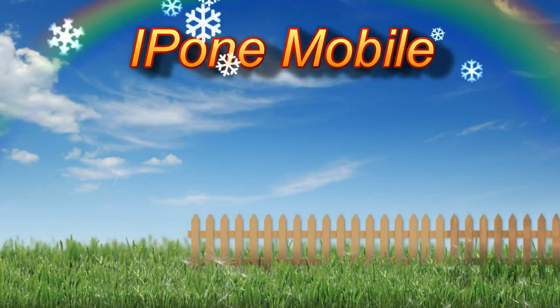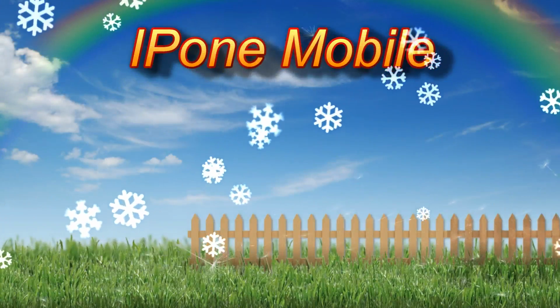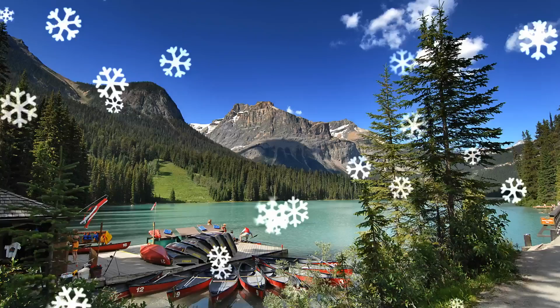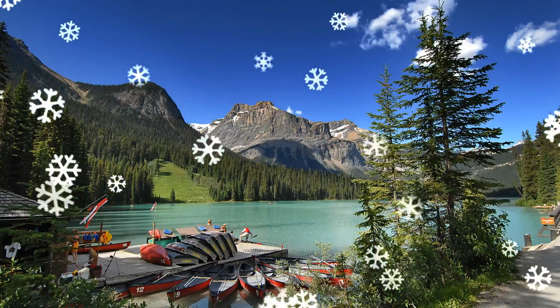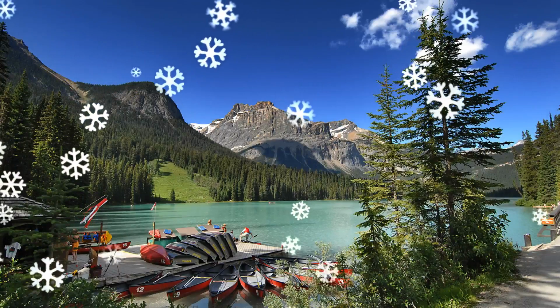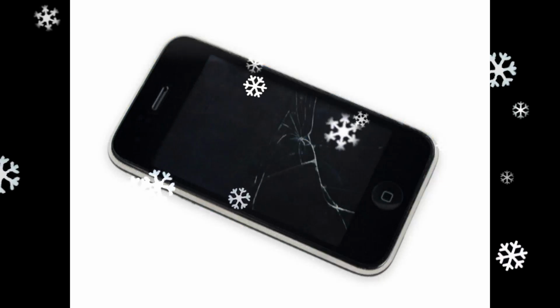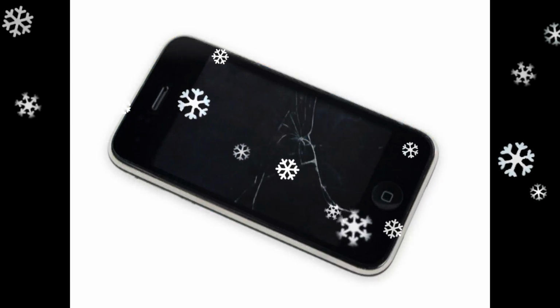iPhone 3G front panel replacement. The display glass is cracked. Keep further breakage contained and prevent bodily harm during your repair by taping the glass. Lay overlapping strips of clear packing tape over the iPhone's display until the whole face is covered. This will keep glass shards contained and provide structural integrity when prying and lifting the display.